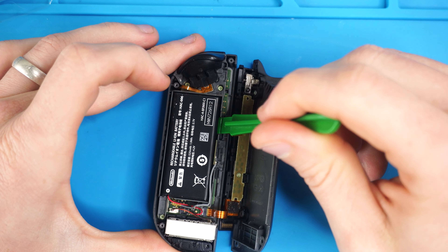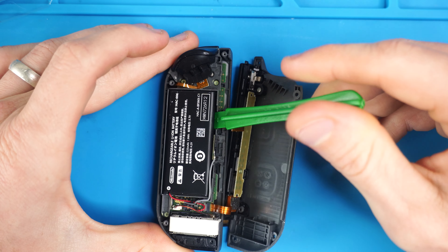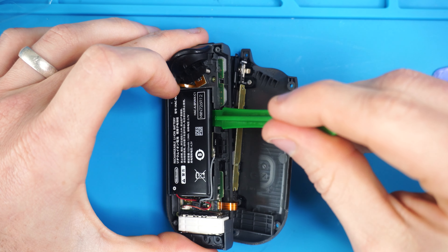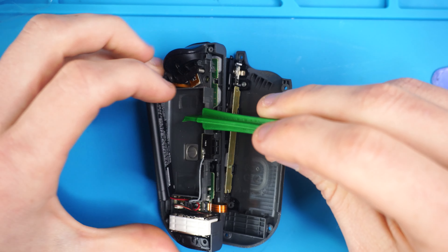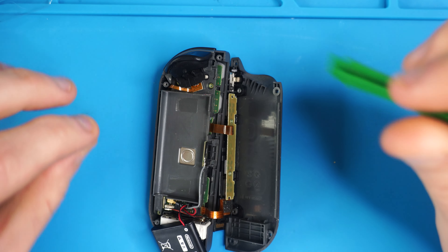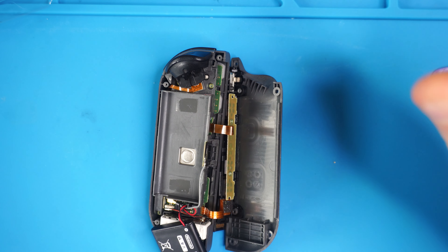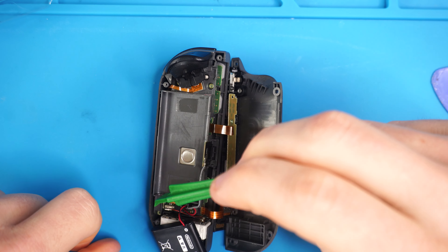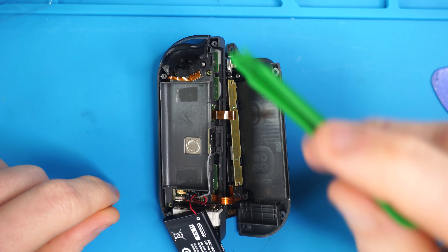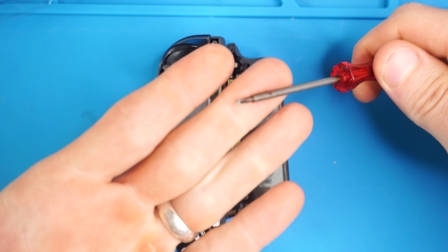You are going to want to rotate the back on the rail side because there is a ribbon cable that you do not want to disturb or damage. Now pry up underneath the battery — there's some light adhesive. Get a little tool in there, pry underneath the battery, then rotate gently to pop off that adhesive and set the battery to the side. In previous videos I showed removing the battery completely, however based on some comments, some people had damaged the battery connector off of the circuit board, so if you're not comfortable with that, just push your battery to the side.